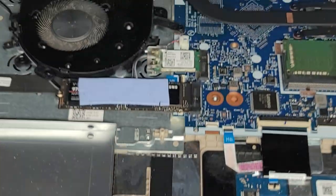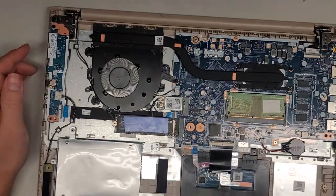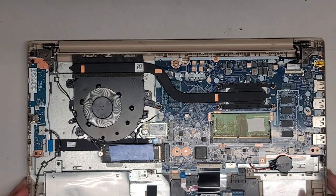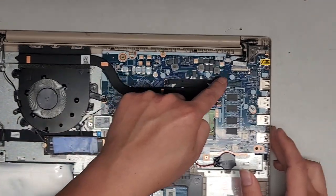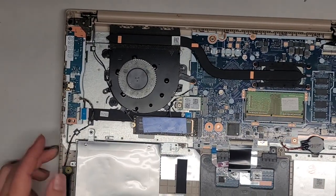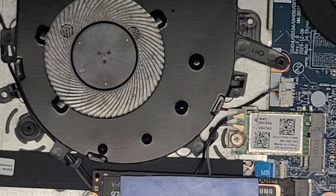You want to be careful with the hinges because now that we have the cover off, you can see we're missing a screw here and here, so the hinges are going to be a lot weaker. Next thing we've got to do is disconnect this cable and the wireless antennas. Let's zoom in a bit here because you'll probably need a better close-up view.